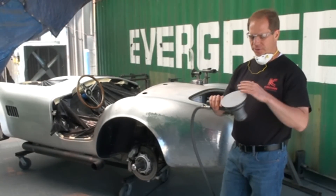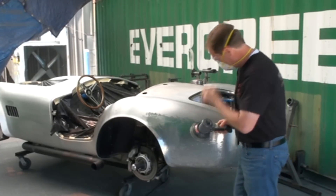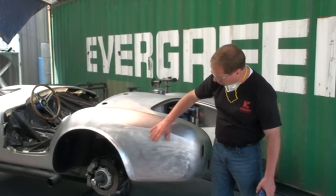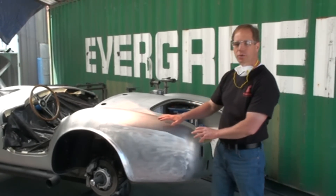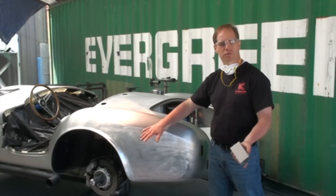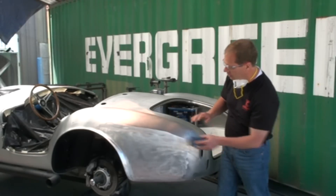Here I have a dual action air sander. I'm using 80 grit sandpaper. I'm going to sand off all the file marks and get ready to brush it. After we're done running the DA over the car and getting out all of the file marks, now it's time to brush it. What we're going to do is try and blend this area into the already brushed part. We grab a block and run usually 220 grit sandpaper. This has all been sanded — we started with 80 grit, went to 150, 180 grit, then 220, then 320, and then back down to 220 grit paper. We'll sand all in straight lines to get a nice brushed finish.